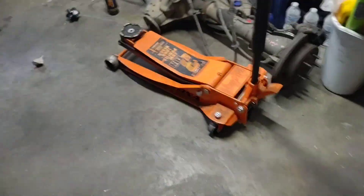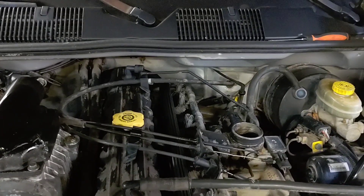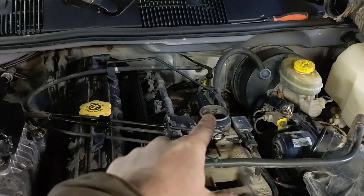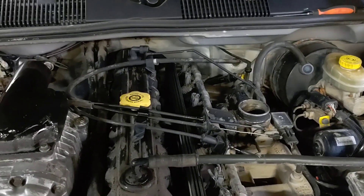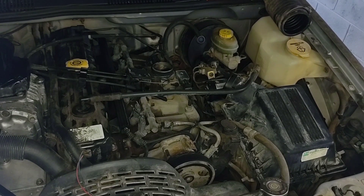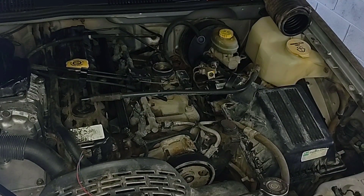I thought I had more aluminum tubes already, but I don't and I don't want to wait. So I'm going to do something I'm not exactly proud of — I'm going to go get some exhaust pipe to build the piece to go up and over. It'll be cheap and easy. I want to build an intercooler anyway, so it'll work for now. I couldn't really find what I wanted at the parts store to build the crossover tube, and since I want to tune it and actually run it naturally aspirated at least to get it running, I'm just going to move forward.